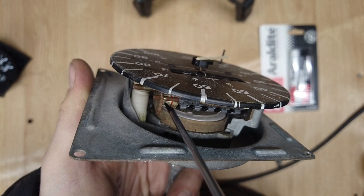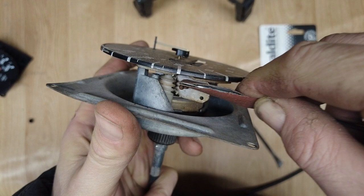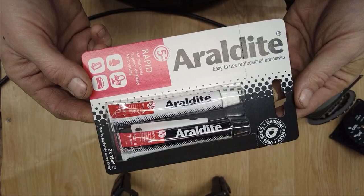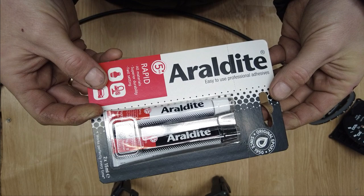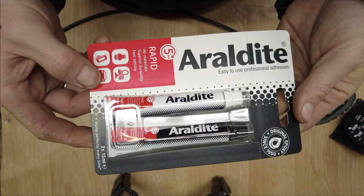Just checking the mechanism, it turns pretty freely. I don't think that's an issue. So at least that's not seized as such. For the glue, I'm using old-fashioned Araldite. If it works, I'll put a link below. So old-fashioned stuff, I guess it's been around for a long time now, but it's epoxy glue, mixed two together, and it sets pretty hard. It's quite quick to set, use a couple of hours for full strength. And hopefully, it's good for bonding plastics and metal, and it'll stick our cog in place. We shall see.